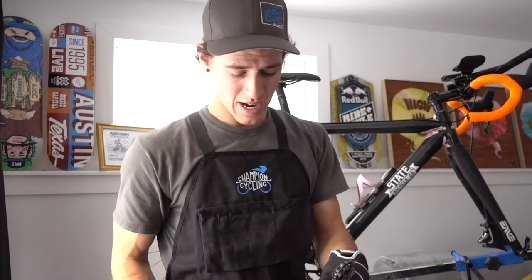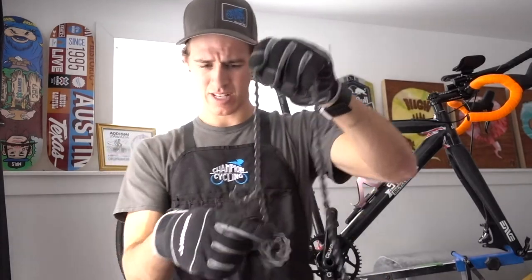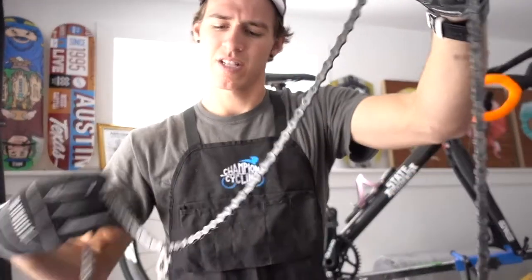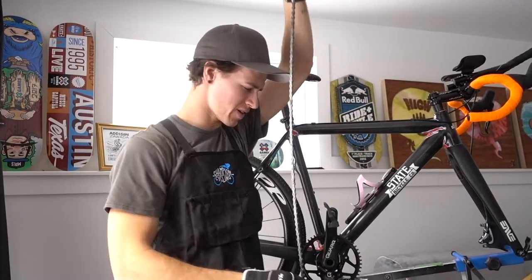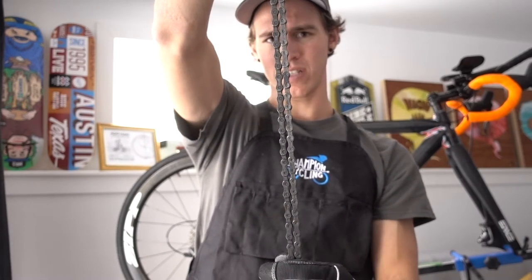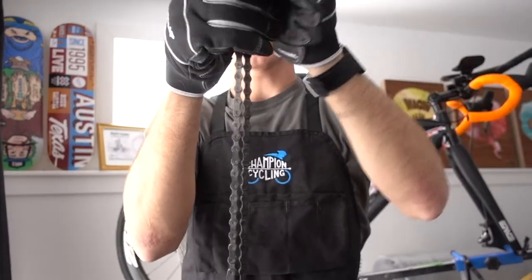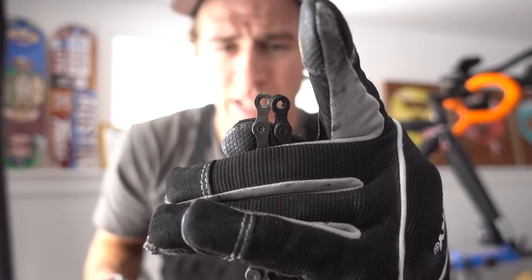Now that you've got your new chain out of the box, make sure you set these new quicklinks off to the side — you don't want to lose those because you need those to put the chain back on. Then take the chain just like you did the other one and unravel it. Make sure there's no knots — you want to make sure the chain is nice and straight with no loops or anything. Hold the chain by one end, then take the old chain and hold them nice and even at one end just like that. Run your fingers together holding the chains together all the way down to the bottom, then flip it. You're going to see if you need to cut any links off — this bike takes a full chain, so they're nice and even at the other end. No need to cut any links off; this chain is ready to go on.